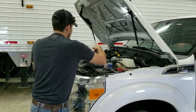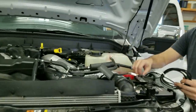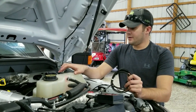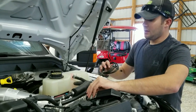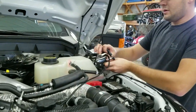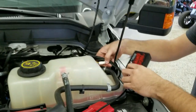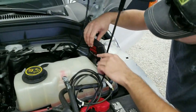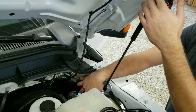Now that it's plugged in, we'll take and run this up. Generally the best place to put this — if you want to leave the switch underneath the hood, that's fine, or if you want to run it in the cabin, that's fine too. There's plenty of length, but most guys like to leave it underneath the hood — keep it concealed and out of the way so nobody sees it. You can run it off this drip tank hose for the radiator and up along this hose as well. On this specific application, we're going to mount the turn dial — the switch for the horsepower settings — right on the backside of the drip tank. Just take some zip ties and mount it there. Then we'll take the module and mount it down by this hood solenoid here.